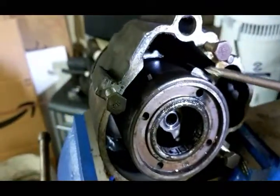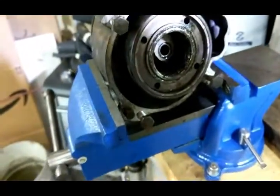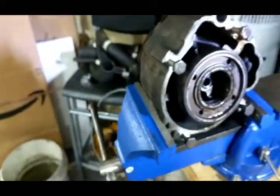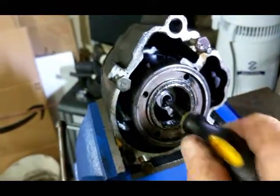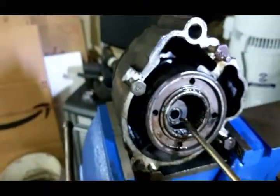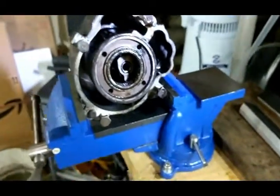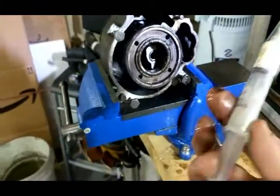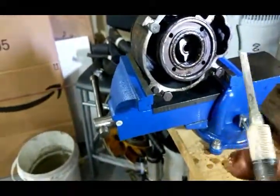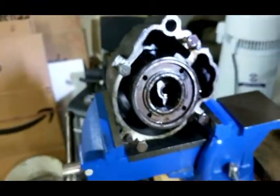So what I've done is spray a lot of WD-40 on it. That plate makes very close contact to the drum and was totally dry — I guess this is 30 years old. I've put some lubricant in there and I've got the pump tilted back slightly in the vice so it doesn't all pour out. I'm turning it and already freeing it up. I'm going to do a whole bunch more of this, then use silicon grease in a syringe with a very fine attachment, put a lot of that in, look around to see what else needs greasing, then put it back together.